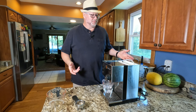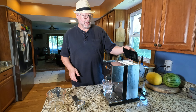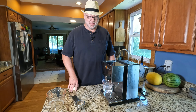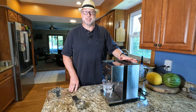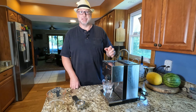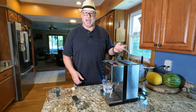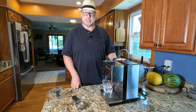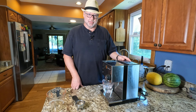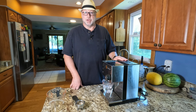With that in, we're all set to go. This machine is now completely descaled and the water softener is completely recharged. This is one of those things you want to do fairly regularly — it keeps the machine in tip-top shape. One thing you don't want to have happen is have your boiler get full of mineral deposits. After a while it gets impossible to descale, it'll affect its ability to heat water, and it'll do damage to the heating element. Both of those are expensive to replace, so it's good maintenance to do pretty regularly.